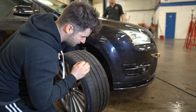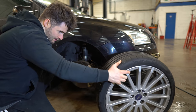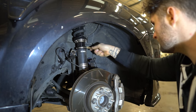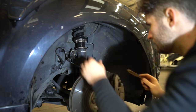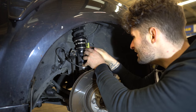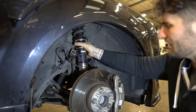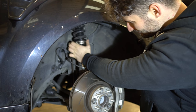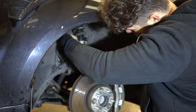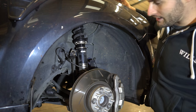Fresh tyres so they're still in good nick — no uneven wear or anything, which doesn't indicate any dodgy issues with the bushes, and they've all been replaced. Trying to prevent binding and causing any damage. Get that VC Racing lubricant and cover that. Now it's sat against it perfectly — take the smaller piece and tighten that up nice and tight. So now we can sit the wheels on and see how much it has lowered.